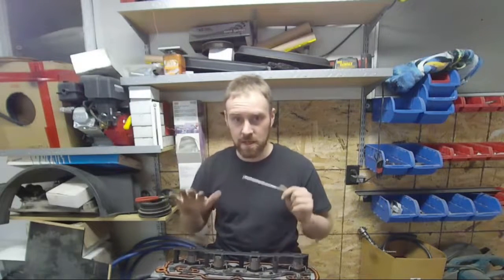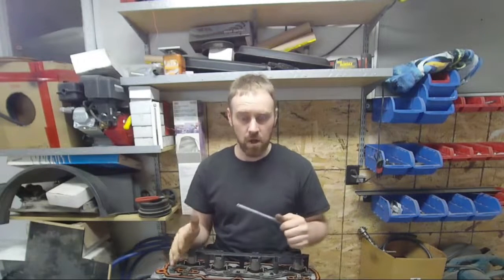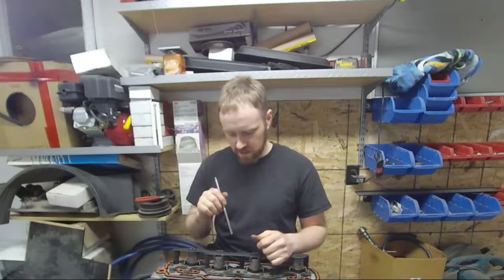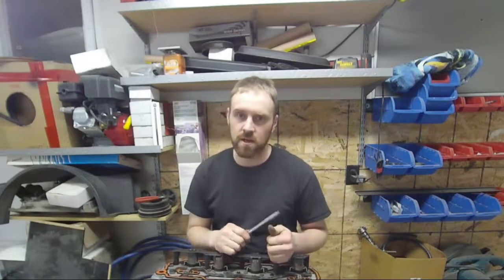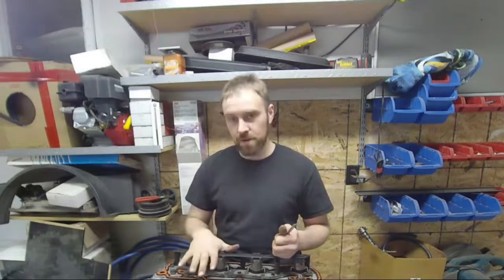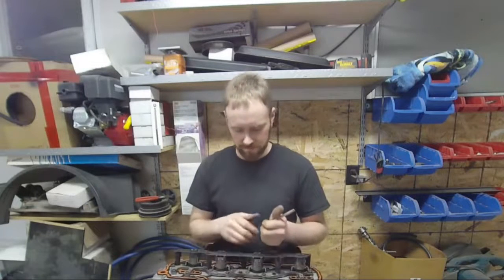If that happens, the VLOM modification is still worthy of doing, as long as you don't go full DOD delete cam and all. The VLOM modification is still worthy of doing because you are going to prevent the lifters from collapsing again after you replace them. And then you still want to get the tune done because, again, it helps prevent the lifter from collapsing. So if the lifter never collapses from being commanded to collapse, it will never lock up and cause a problem. As far as the odds of this tool working, they are very high.